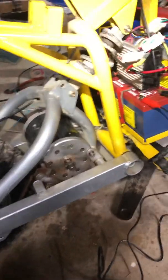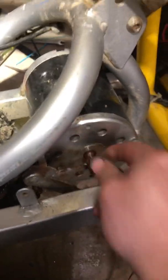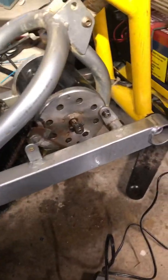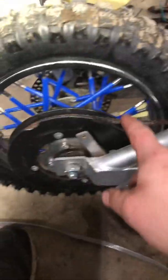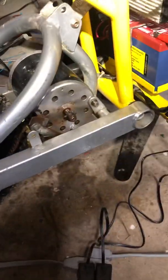I have an MX 650 here with LiFePO4 batteries. Today we're changing the front sprocket only — that's going to give us more torque. It's a quick, easy way to get more torque. If that's not enough you can change the rear, but that's more of a headache, so start with the baby steps and cheapest option first.